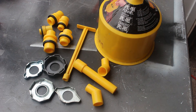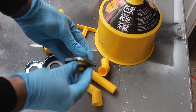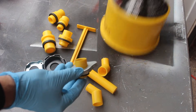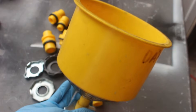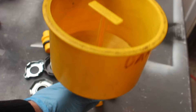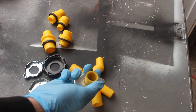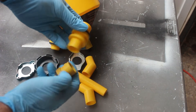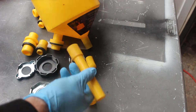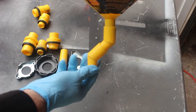Now that the old coolant has been drained out, it's time to put in the new coolant. You could just add the coolant using any funnel you have lying around, but this is where a spill-free funnel comes in handy. It locks on to the top of the radiator, allows you to hold a whole bunch more extra fluid while you bleed the air out, and when you're done there's a stopper that allows you to remove the funnel full of coolant and either dump it into a container or into the overflow reservoir. They come with a variety of different adapters to work with different types of radiators, both for how they seat in and for the type of cap. There's also a height extension, as well as angled extensions if you need to get into awkward places.